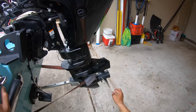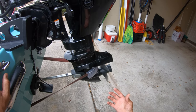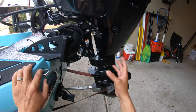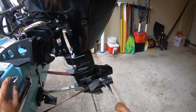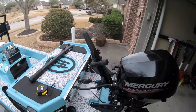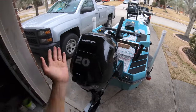I've already had three strikes to the lower unit. The aluminum prop has taken the brunt of the damage — I'd rather the prop give way than something in the lower unit like the shafts and gearing get jacked up. I'll probably buy another aluminum prop, but it can all be solved with a jack plate back here and not worrying about porpoising.